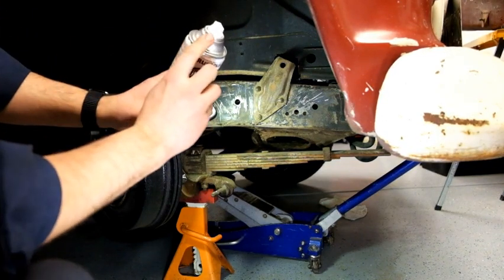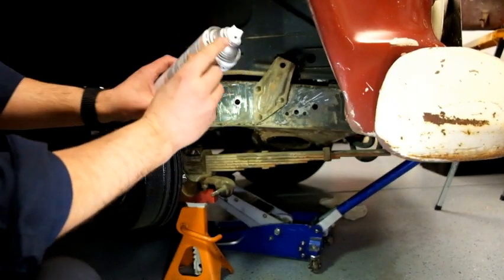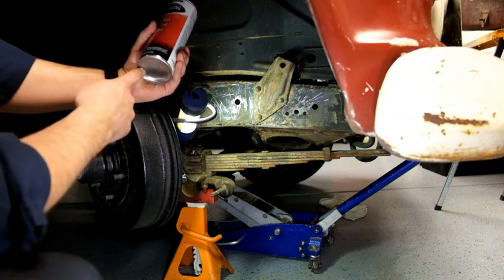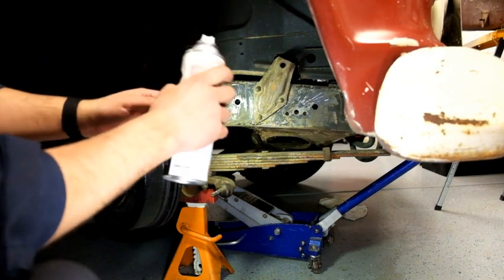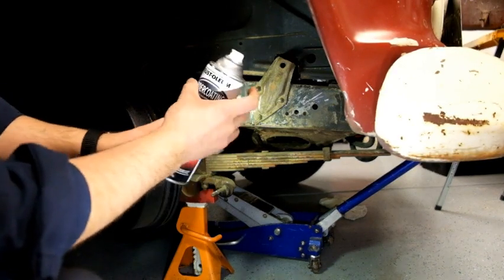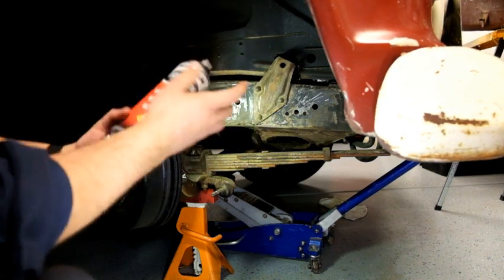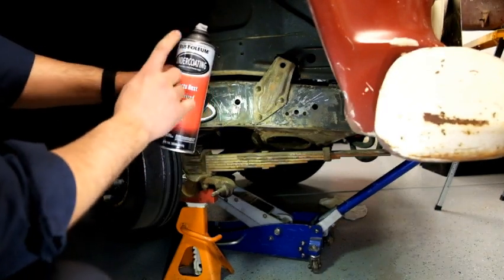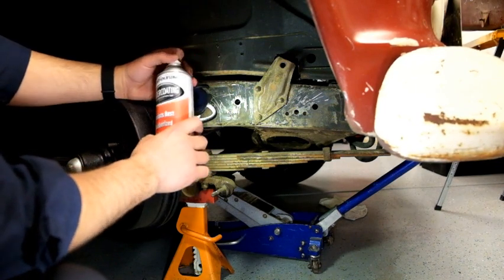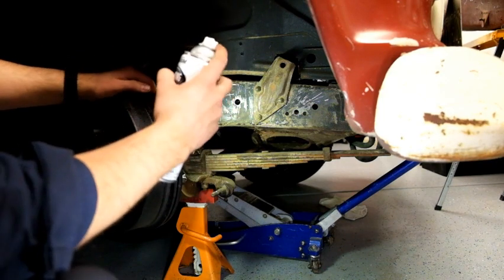And make sure you got the little dot pointed towards the nozzle, because the red dot is where the pickup tube comes down towards the front of the can. So wherever that dot is, you'll get a ton of spray. That way, if you're aiming down, or if you have to aim up, put the dot on the backside and spray up. I learned this from a student whose mother actually worked in the consumer complaint line for Rust-Oleum. So, good thing to know.